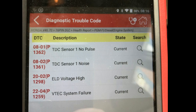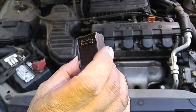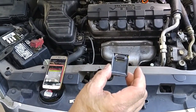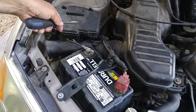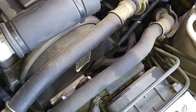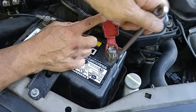We have a car with compound problems. The check engine light codes indicate the electronic load detector is malfunctioning, and the other problem is the camshaft position sensor — which Honda calls a top dead center sensor — is not working either. The ELD is this little doohickey right here, which I picked up at a salvage yard. At a store it could range from thirty to fifty dollars, so while I was there I picked up three of them. I'll start with the fuse box to replace the ELD, then replace the TDC or camshaft position sensor, which looks like this.